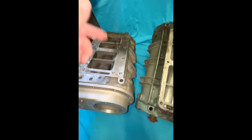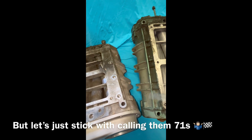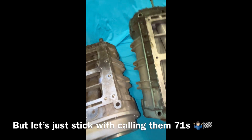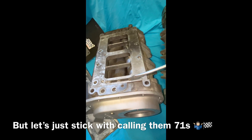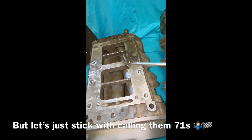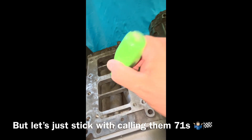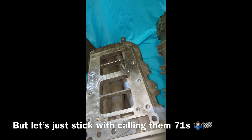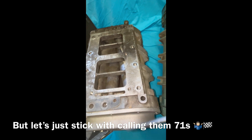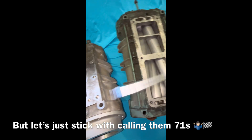This one here is actually a 6V92. I like calling them 8V71 just because of the traditional 71 series, but if you want to know why it's a 92 — everything's basically the same except for a couple of things. The cases, the housings, the volume, the rotors, the triple-lobe rotors — everything's the same on the 92 series. There's also a 6V92 and an 8V92 out there.